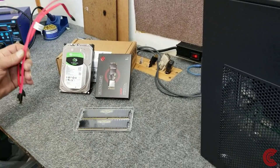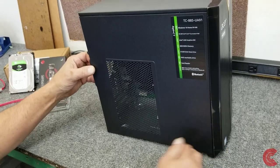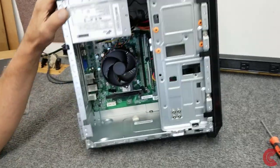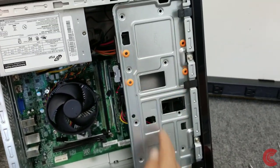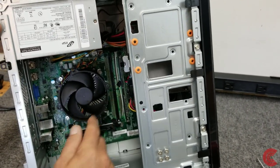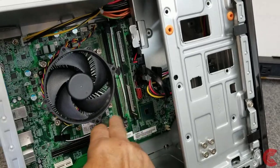I've got a couple of different types of SATA cables I may or may not use depending on what I find in there. So I'm going to take off the side panel — there's just two screws on the side, like any tower, it slides right off. You can see in here the 3.5-inch hard drive is going to go on the back side of this plate, and Acer was kind enough to give us four mounting screws for that. The PCI Express M.2 drive is way up behind the optical drive bracket, which we're going to remove. And of course here are our two RAM slots.